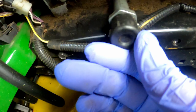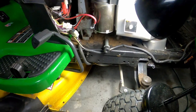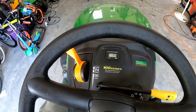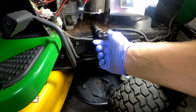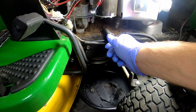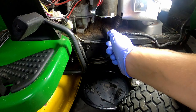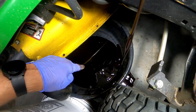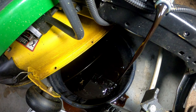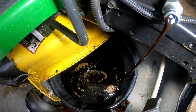This is going to be your drain valve. You're just going to push it in and then turn it to the right, and it's going to come out of that little groove. First, make sure you have your drip pan in place. I did let the engine run for about 10 minutes so the oil should come out pretty quickly. Make sure your pan's underneath the drain plug. It's also a good idea to loosen the top cap so it'll drain a little bit easier. Just push it in, turn it clockwise, and it should pop right off and immediately start draining. Let that drain for about five to ten minutes until it comes to a slow drip. While that's draining, go ahead and also remove the oil filter so any oil trapped in there will also drain out.